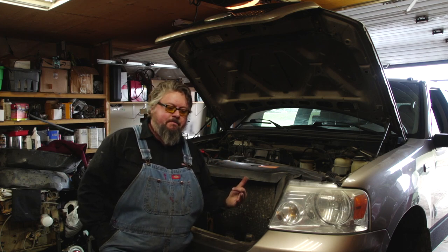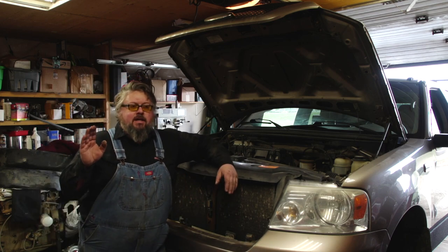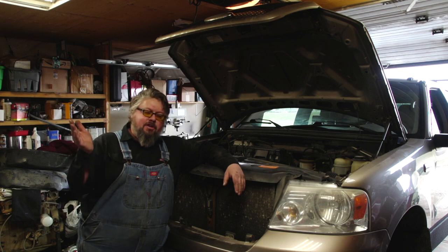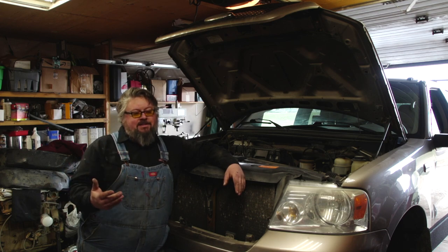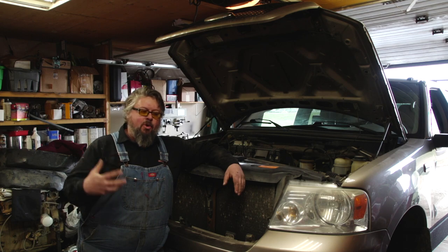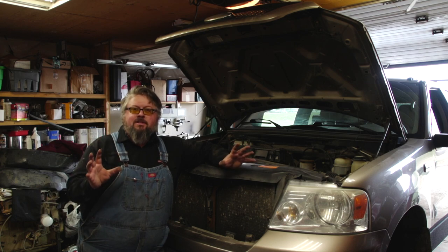Now, if you've got vacuum down at the hubs, but you put it in four-wheel drive and it doesn't engage, that's where I did the power test. As you guys saw, the one pin is going to have power full time. The 4x4 module provides the ground. If you're not getting that ground, your hubs are not going to engage. And then, if the problem isn't the switch, that's something that I could troubleshoot more in depth afterwards. I just want to keep this with the IWE solenoid switch for the vacuum.